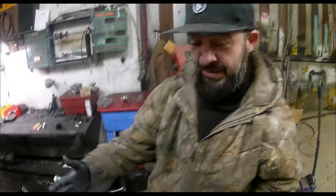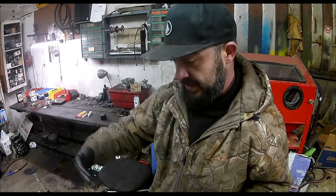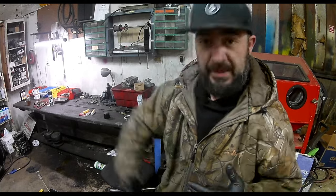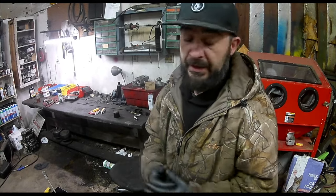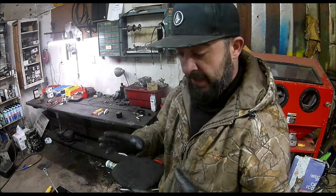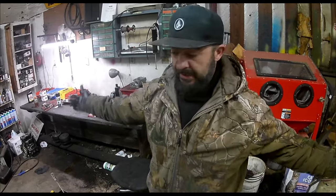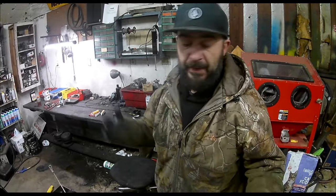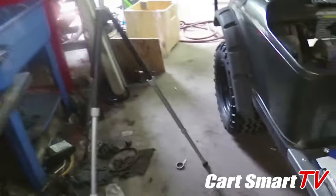Guys, so now you see I can actually let it sit here and run for 20, 25, 30 minutes and get it really good and warm, give it some gas and make sure it's taking in like it's supposed to. It's basically gaining the RPMs that you're looking for on these motors. And so it's going to be a really good break-in process, especially for the main purpose of being able to find the leaks that might be happening or possibly bad rings on one side. So I mean, it just could help out with anything like that. So hope you guys enjoy. Loaded back up in its crate over there, and bolt it back down to the crate.